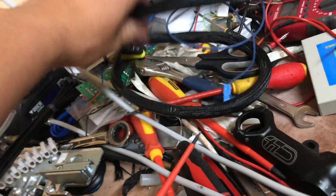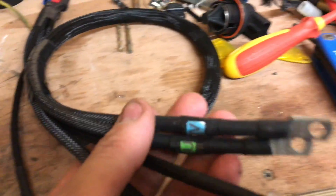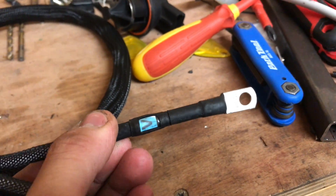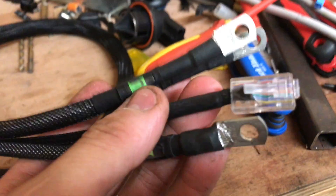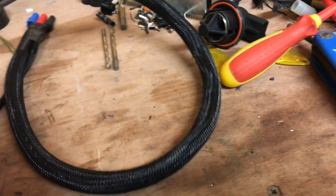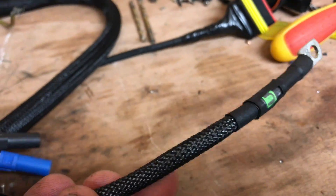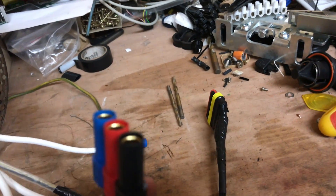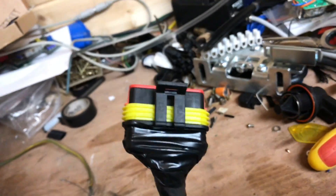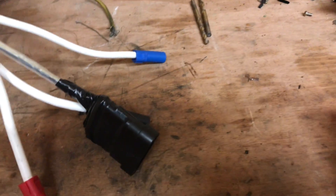This is the cable that goes between the controller and the motor. As you can see, it's a very nice wire labelled with clear heat shrink. I'm using an ethernet connector on this end for the hall wires. This cable took a bloody long time to make, because each individual phase wire is also screened in braided cable sleeving, and then the entire thing has braided sleeving on top. On the other end, we've got the XT150s and the six-pin hall connector, which just plugs in there.